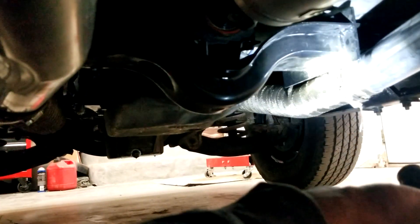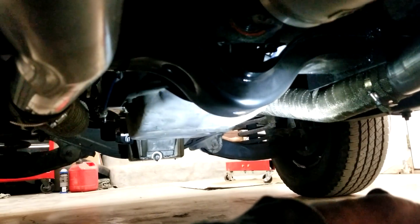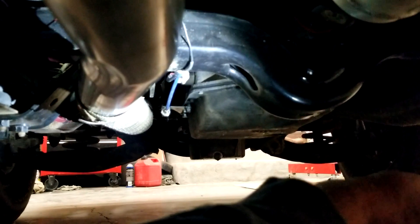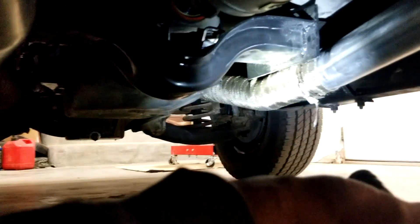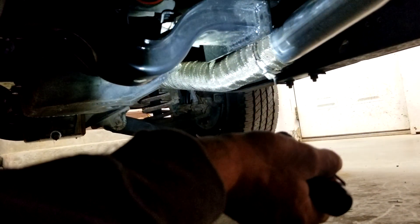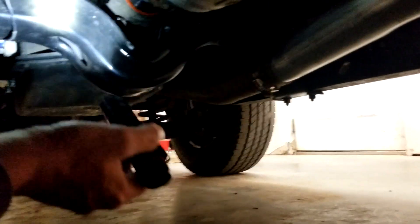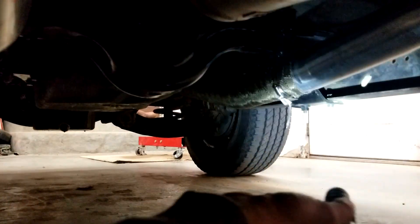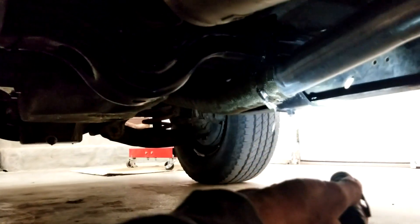You can do this even if you have no welding experience, man. Just look on YouTube, get you some quarter-inch steel, get a cheap welder, get a cheap cut-off wheel — you can do this. I promise, even I could do it. I have a seventh-grade education, so y'all can do it too. That right there — that's the quarter-inch steel we cut. It looks like probably three and a half inches by probably ten. We just sliced the crossmember into thirds, and then you bolt back in the outer sections here and here.